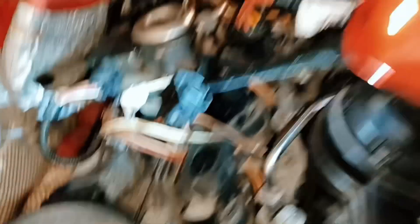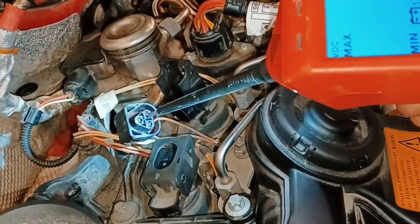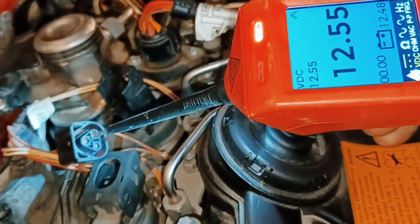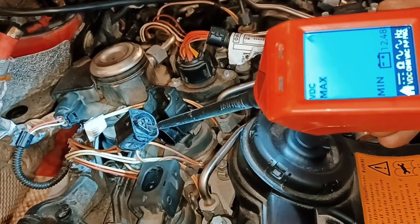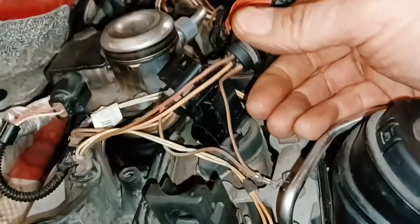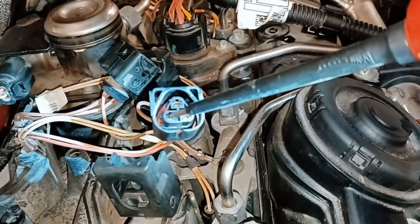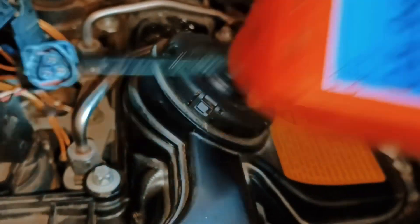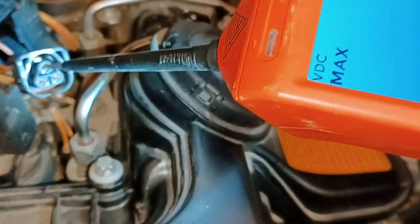How do we work out what the problem is? Let's go back to our coil connector. We've got several things we can do, but first we'll look at the voltage. We've got ground on the signal wire — remember that. On the 12-volt side we've got 12 volts powering the coil, which is correct. But we've got a ground on the signal wire, and we shouldn't. Let's take a good coil — we know number one works. Same white wire, checking for ground: we don't have one — we have 3.94 volts. That's what we should have. So on the good coil: 3.9 volts signal, 12 volts supply, and a ground.